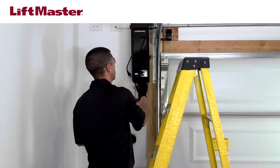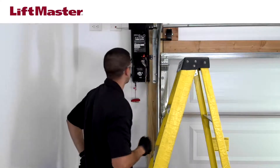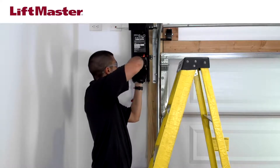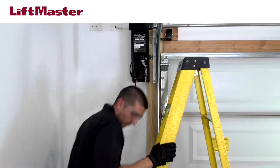You'll need to access the battery compartment. On wall mount models, lift the cover. Remove the battery compartment cover. Pull the battery out and disconnect the red and black wires from the battery terminals. Remove the battery and dispose of in accordance with local codes.